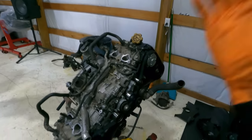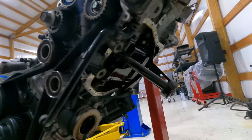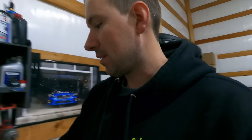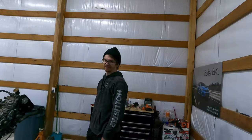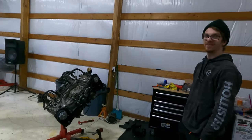30 minutes later — full bare long block. Got that oil pan off. It actually ended up having an upgraded IAG oil pickup. Definitely some dirty oil in there. Got the oil cooler set to the side so we can change the gasket on that just to be safe. We'll get everything cleaned up. For now we're going to go on a parts run, go to lunch — let the GoPro charge because the time lapse really kills it. When we get back, we gotta decide what we're going to do. The fire sale is in the pen outside — we're not going to crawl outside to work on it. So if we get the clutch on lunch, come back, clean up the oil pan, clean up the oil cooler, get the oil pan on, get it sealed, put the clutch on it, sit it in the car, then get the hatch in here and pull a motor. Time to eat.